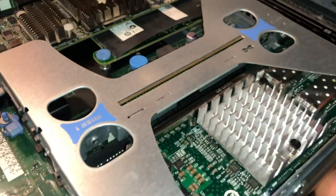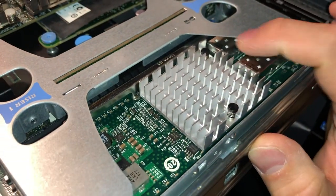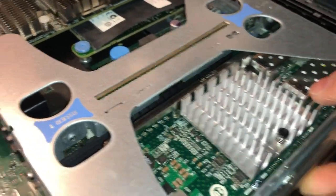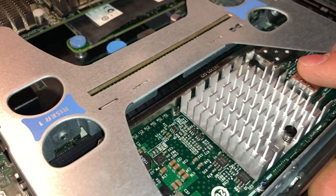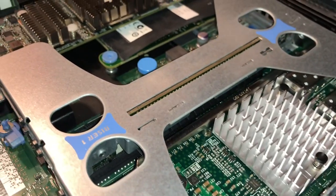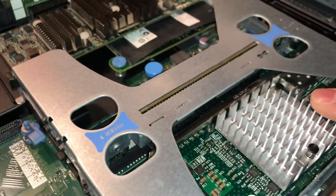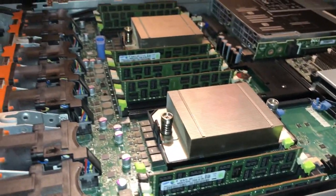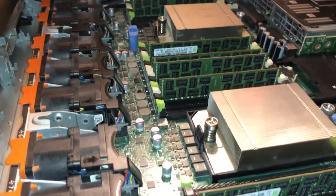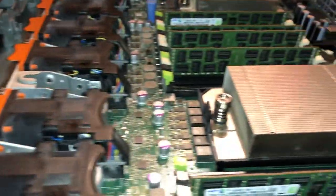Here is the 10GB card — dual port. So we have a 20GB LACP EtherChannel to my switch, which gives enough bandwidth to avoid any saturation. My bottleneck is still the disks, even if I have SSDs. Bottlenecks are always going to be the drives.